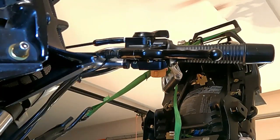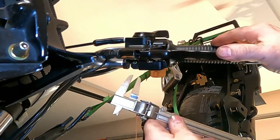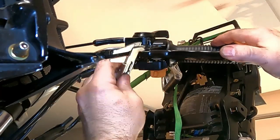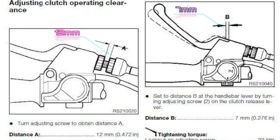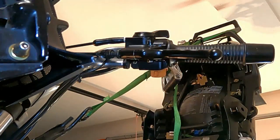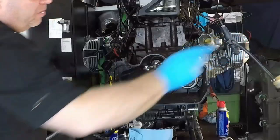The next goal with the adjustment out back, what we're trying to do is have the free play for when the clutch starts to kick in at 7 millimeters. In other words, we want to have 7 millimeters of free play up here before the clutch starts to engage. So we'll reference our calipers. So what we have out back here is